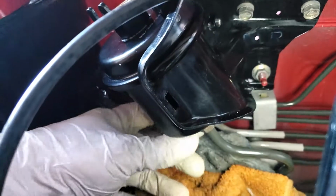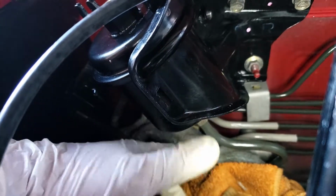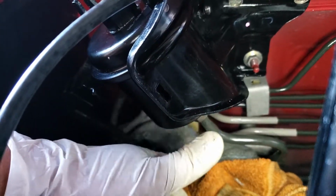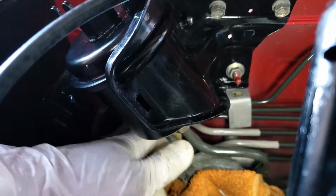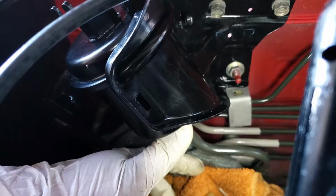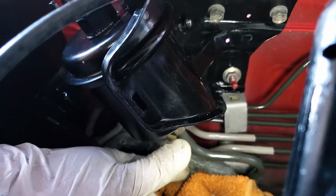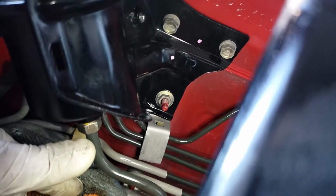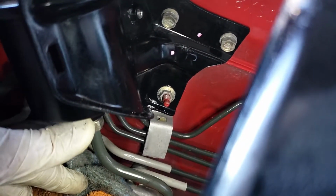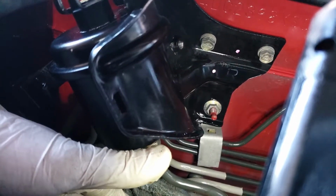Remember this right here, the bottom piece here. Line up this with the filter perfectly. Okay, make sure they stay perfectly, and hand tight goes in first. Make sure to go all the way hand tight first, because if you don't line up perfectly, you will mess up the thread. When you mess up the thread, you're in big trouble. Okay, the filter, you need a new filter.